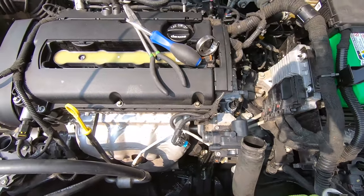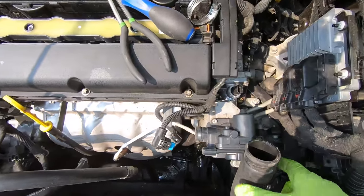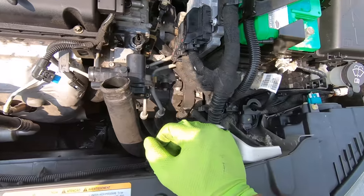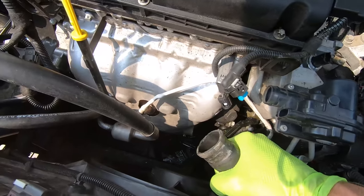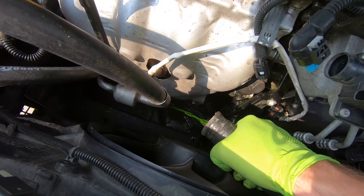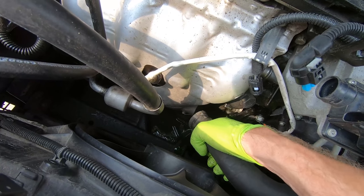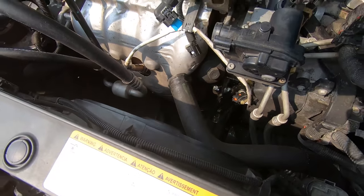I was just draining this — figured this was the easiest way, right through that hole, aiming the hose down to my coolant pan underneath. When I took it loose, it might not be very visible, but it looks like there's some stop leak stuff in there. That's how that stuff builds up with gunk, and that's not a good sign. When I'm pouring it out it actually looks like it has oil in the coolant — though I'm not even actually seeing any at the moment.